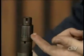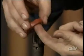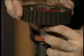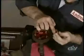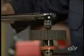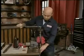Then, apply a light coating of assembly lube to the cam seal. Place the cam seal on the cam, then set the key in place and slide the gear onto the end of the shaft. Apply some light oil to the cam gear bolt before installing it, and torque the bolts down to 25 foot-pounds on each cam.